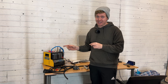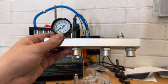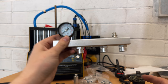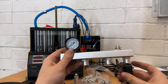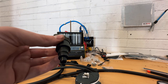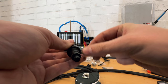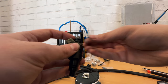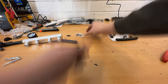Now back onto the injectors because I think I've worked out how to use this machine, but I do have a problem - my injectors will not fit in there comfortably. I've got loads of different attachments here to make these different sizes, but none of them fit. This is the closest I can get, but even with an O-ring on there it's not going to fit without leaking. So I have devised a bit of a plan. That is my injector number one, which I am now going to put another seal on - the same as the one on the bottom - on the top, and then an O-ring. Hopefully that will do the job.